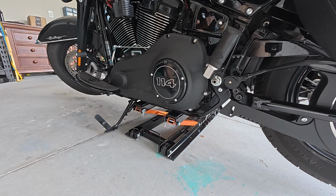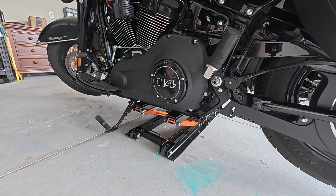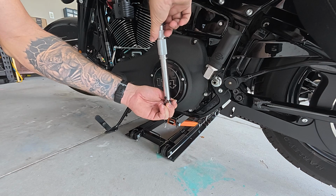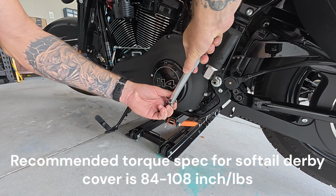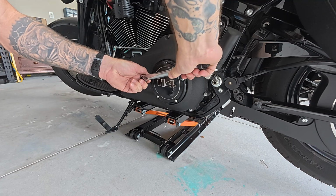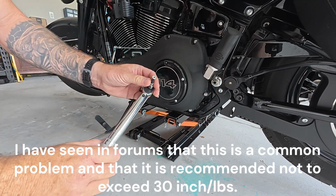Okay, now I'm just curious. I'm actually going to torque one of these other screws just to see what happens. Hopefully I don't break it off in there. But I want to see if it was just that screw or this wrench before we put the new derby cover on. So, exercised it. Now I got it set to 90 inch-pounds. That worked. Look at that. That did not.